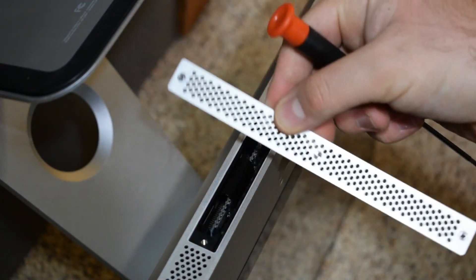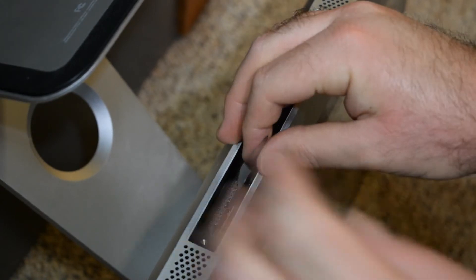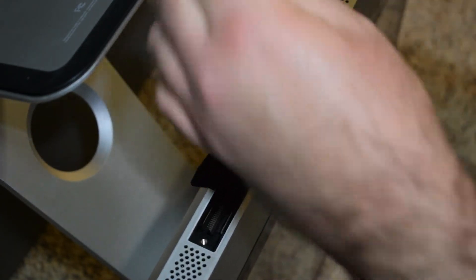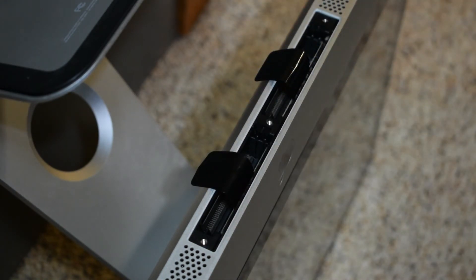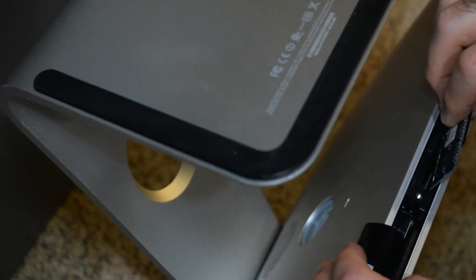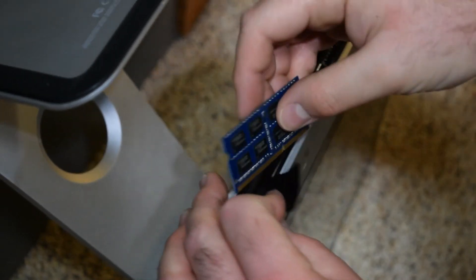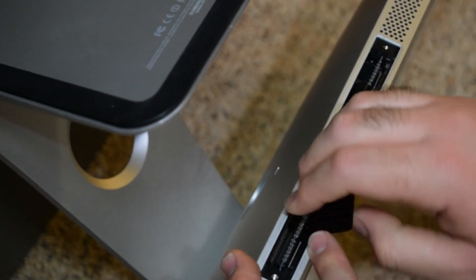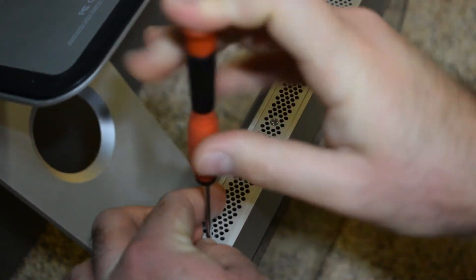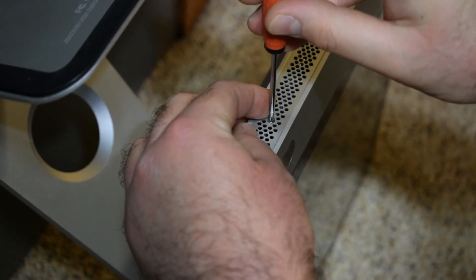There are little tabs you pull out, then pull up with some force and the RAM sticks pop up. Each slot has four notches — mine only has two sticks for four gigs total since I mainly use this machine to control some virtual machines and run PuTTY, nothing task-heavy. My 2011 has 16 gigs by comparison. To install new RAM just do the reverse of everything shown here. These are very easy upgrades that make these machines a lot faster and even comparable to some modern computers. Thanks for watching, see you in the next one!